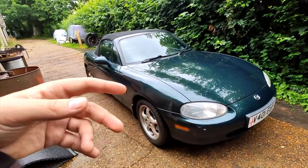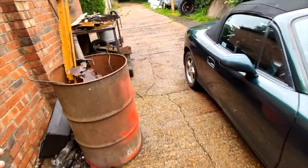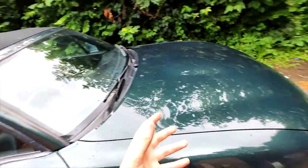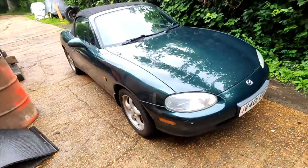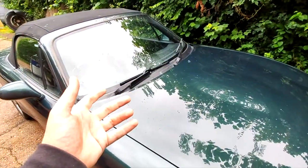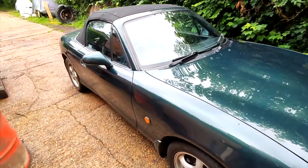We've just come back from the retest on the MOT. I changed these two brake lines, which you've seen, and when I was doing the discs on the other side I got one of the brake hoses twisted — just untwisted that — and it's gone through fine. They did advise changing the wipers, but I just cleaned them; they're pretty new anyway, so they're fine.